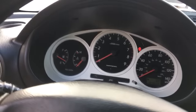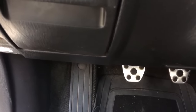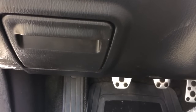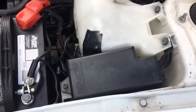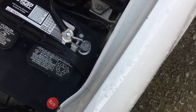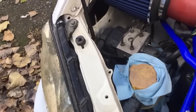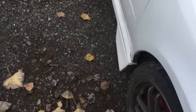First I went through all the fuses and I would pull them off, and I would also pull off the relays while the fuel pump and the cluster were turning off and on really quickly, and nothing changed. I also went over here to pull all of these fuses and relays out, and that nothing would change. I checked my grounds and they were fine.